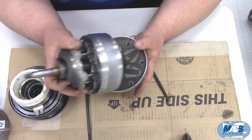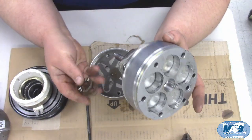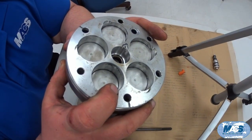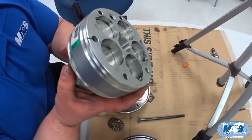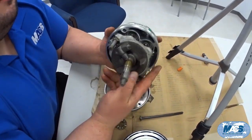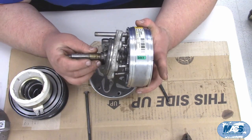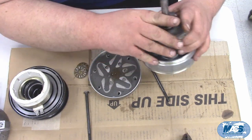Taking the back head off, we can see the piston assembly and the thrust bearing. We see the five cylinders — hence this is a V5 compressor — and we can start to see some of the problem. This compressor is actually locked up. The shaft is slightly bent, and this compressor also had some type of contaminant in it.